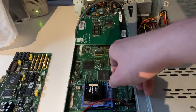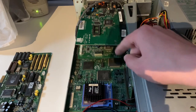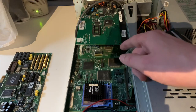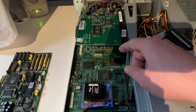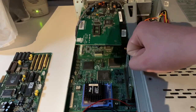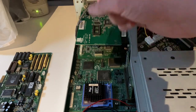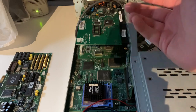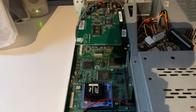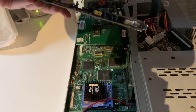And because you only have three ISA slots, the bottom slot is now filled with the SoundBlaster Vibra 16. That is now currently in use for all the games that the Gravis Ultrasound doesn't support, especially AdLib compliant games that use FM from the AdLib. Definitely need a SoundBlaster for that. The AdLib performance on the GUS, I haven't actually gotten it to work properly on that card, and I've heard some samples and it's absolutely terrible on other Gravis Ultrasound cards, so I prefer to just keep it this way and use both cards with a loop cable at the back.